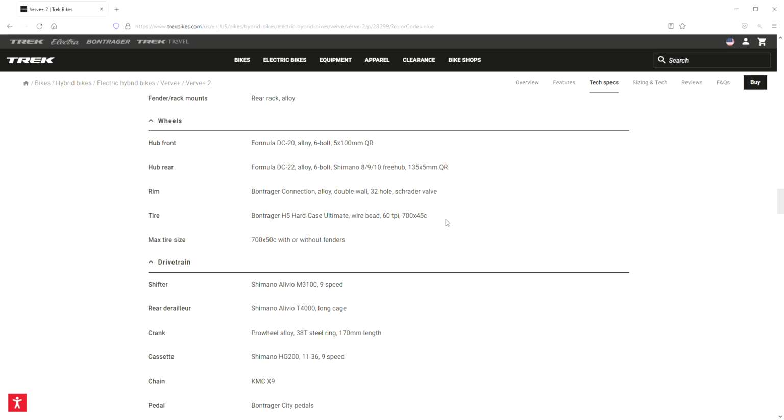The reason being is these are heavy bikes. And when you have a heavier bike, it's much easier to bottom out the tires. So having a little bit more air volume is not necessarily a bad thing. And with that assist, it doesn't really ride like you're on a big, dragging tire because you have that extra push. But it gives you a little bit more added stability for higher speeds, a little better traction when you're cornering, and definitely more air volume so you're not bottoming out.